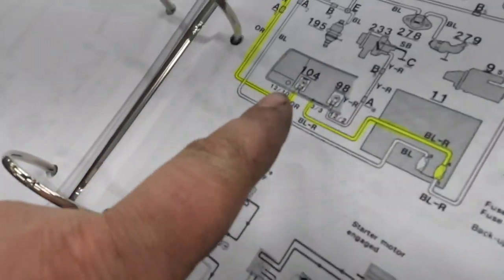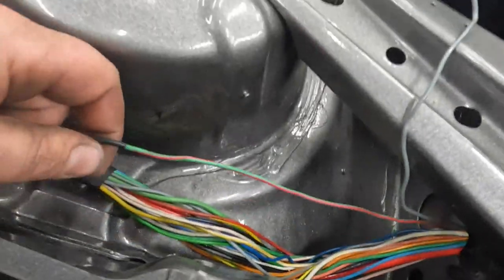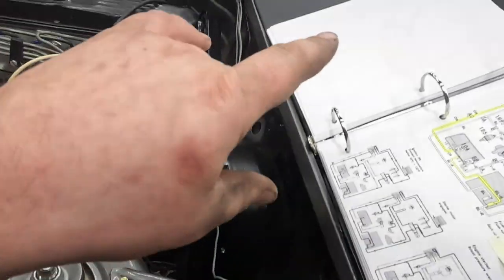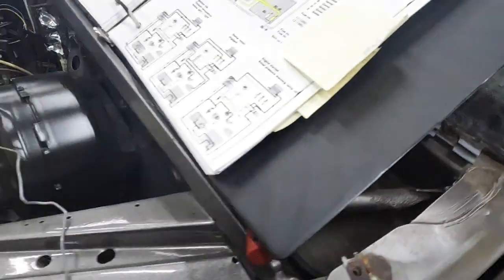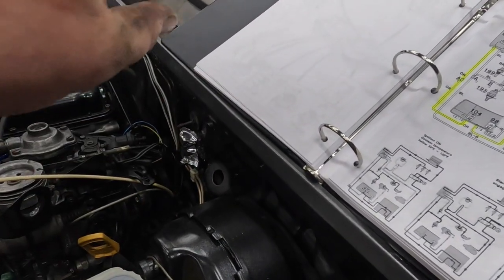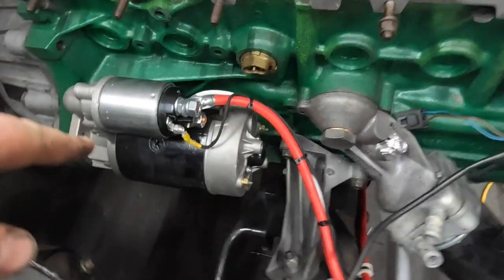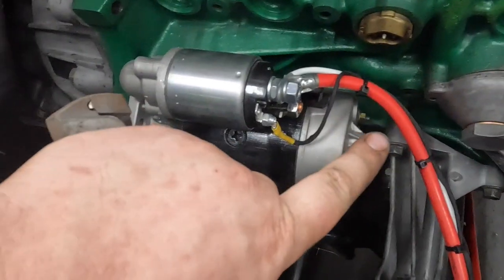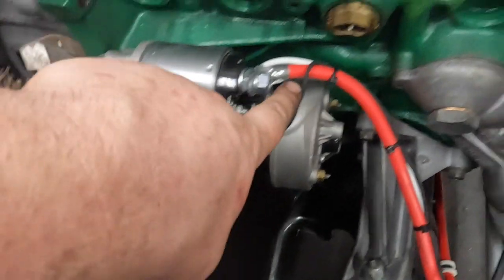For the wire to the indicator light, I just used the existing wire — this lovely salmon pink color. For the control wire from the switch, I hijacked the courtesy under-hood light wire, because that already runs in and has a junction at those two big connectors down here. And everyone has a flashlight in their phone which is ten times brighter than the old ding-a-ling there anyway. Over here I've tidied up the battery cable and ran the starter solenoid wire. Since we switched to the older Bosch direct-drive starter, we have a ring terminal instead of a spade connector, so I just had to lengthen that a little bit.